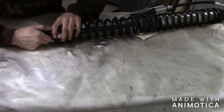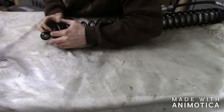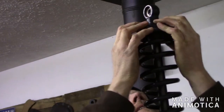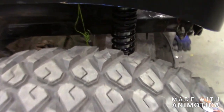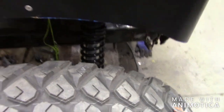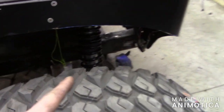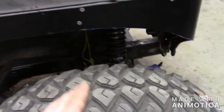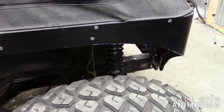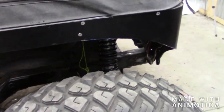See if I can do this without pushing the coilover up in the air — just like so. The coilover is installed, obviously pretty simple, fits in there really good. I might have to do a little more trimming in there, and one thing I noticed is it's pretty close between the coilover and the frame. I'm going to have to cycle it once I get everything done and see where it's at. Worst case I'll just have to notch the frame a little bit — not a big deal, pretty simple.